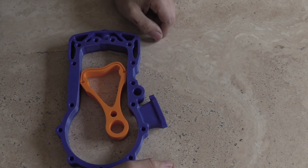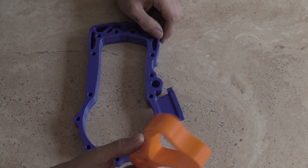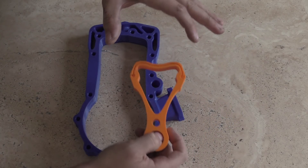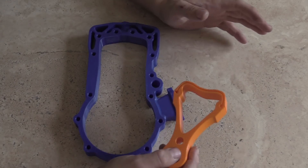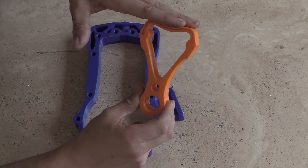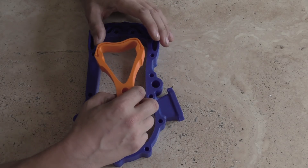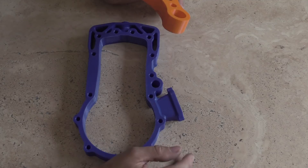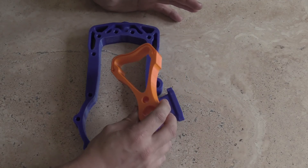Welcome back to the shop. Just a quick video about this — I've 3D printed out the P-rod. This is a 1-2-5 arrangement. A lot of people keep saying how can it be a bore or a cylinder — I'm using terminology that everyone understands. You'd call this a piston crown, this the rod section — it's its own entity. For rotors they call them housing, rotor, side irons — that's because it's completely different. This is almost like a piston engine.